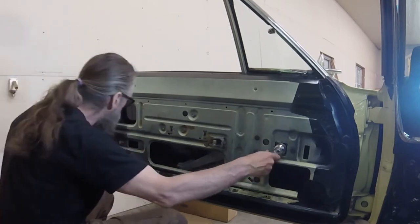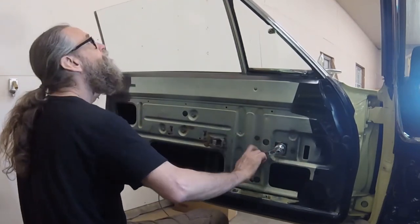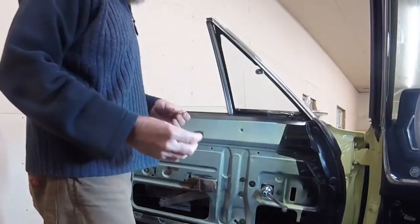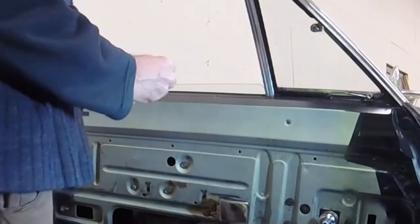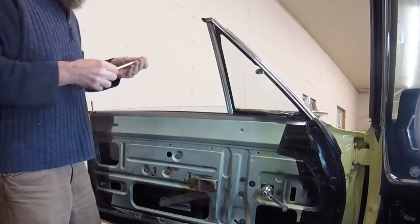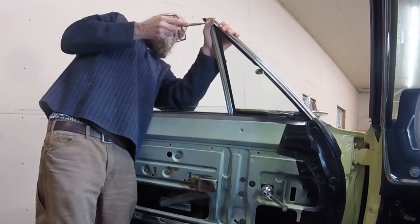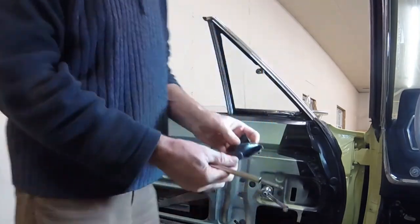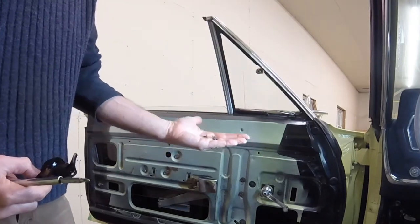All of the loose bolts can now be tightened with the same 7/16 wrench. The next piece to reinstall is the wedge-shaped rubber stopper. Its mounting screw also fastens the window track to the vent window frame. Finally, the door end seal can be reattached. It's fastened with three sheet metal screws.